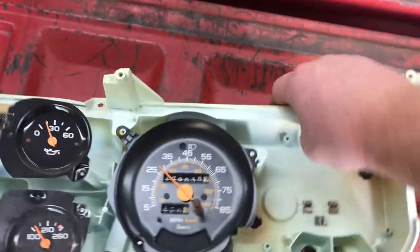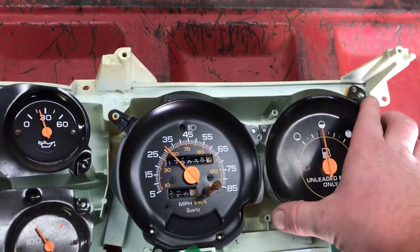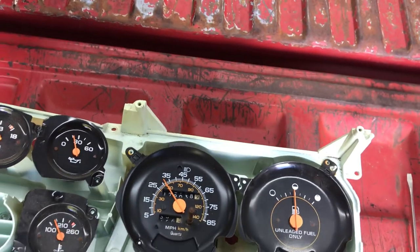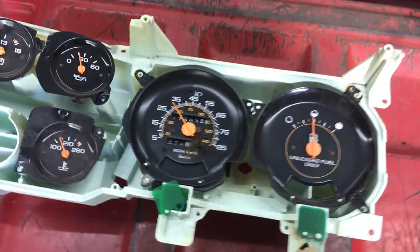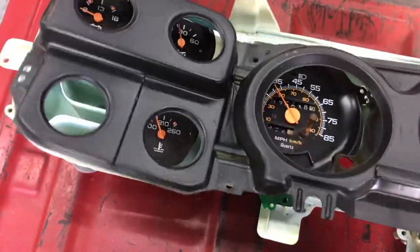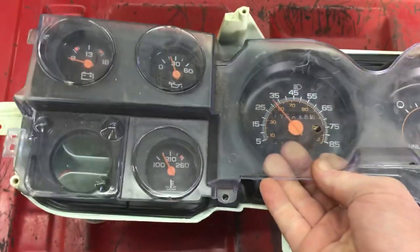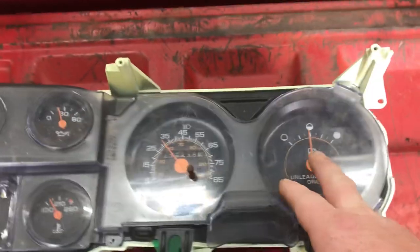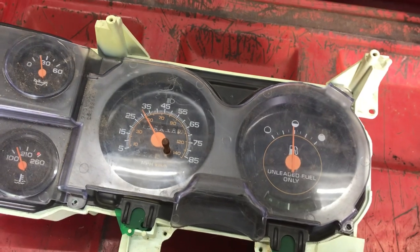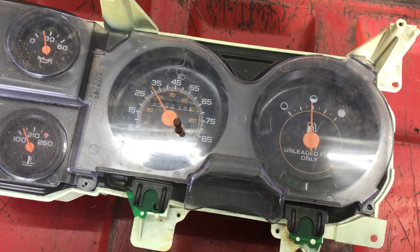It's a little time-consuming just getting the gauges out because you do have to pull the dash loose. You don't have to take it all the way out, but you do have to take the driver's side loose, pull the clips out, maybe one of the bottom screws, and you should be good. I know most of y'all probably already knew that, but I like to pass it along. I was having trouble with my fuel gauge. When I took the gas tank off the truck, I went ahead and ohmed the sending unit out — I've got a video on here if you want to know how to check and make sure your sending unit's good; go down through my videos, it's down there somewhere.